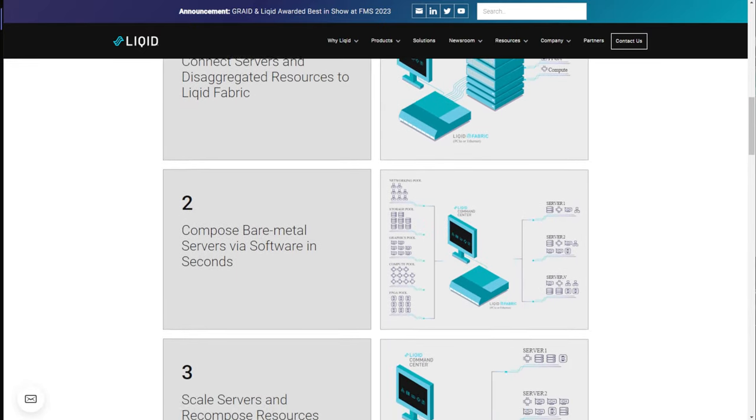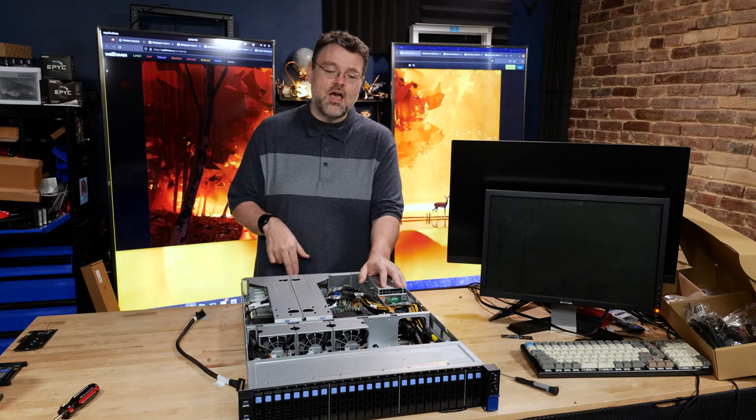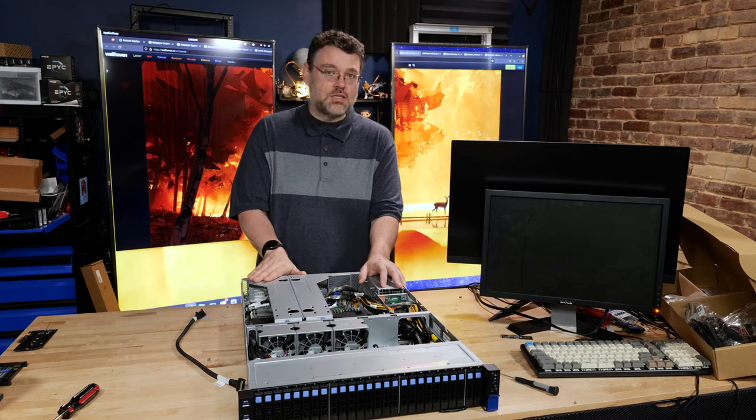Anyway, you give up 4 of your U.2 connections, you get another X16 slot. That's going to be 60 gigabytes per second of disaggregated bandwidth off of this thing. At that point, you're pretty much pegging your CPU for whatever overhead you're doing for your storage and your internal storage redundancy, plus parity calculations, plus whatever else, you're on ZFS, something like that. 64 gigabytes per second per chassis, that's going to be the fastest Ceph cluster that you've ever used, period.